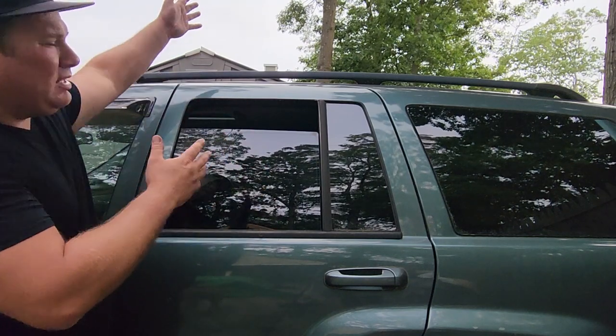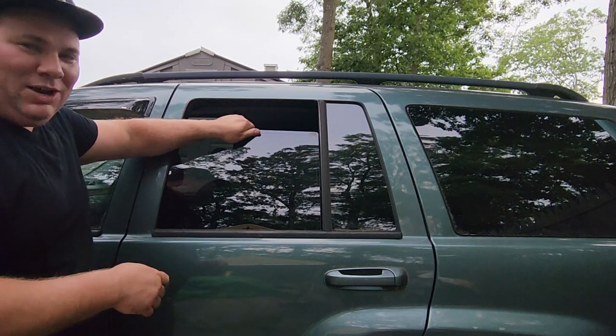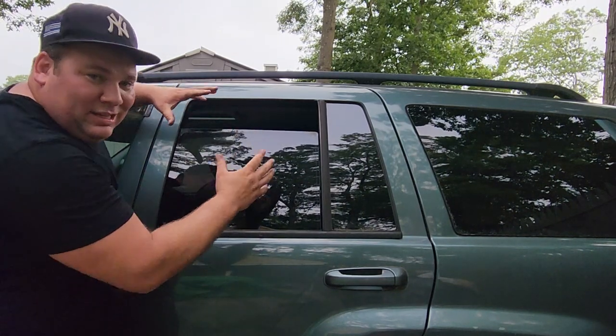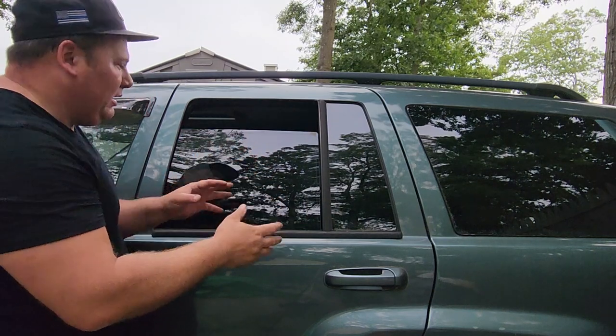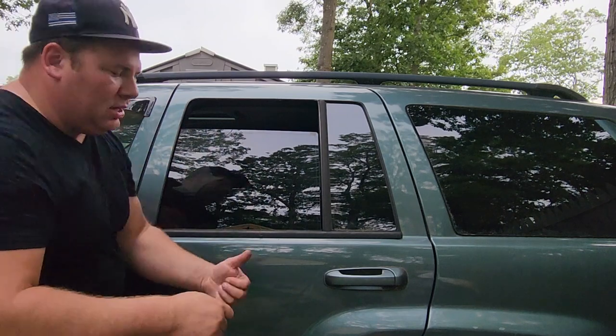Clouds are rolling in. We got our windows stuck down — no matter what you do, it won't roll up. It did go down a little bit more. I was able to pull it back up to the spot, but I heard a snap. I think it was the regulator breaking. So this is where we're at: storm's coming, window's stuck down. We got to take off this door card. Let's do it.